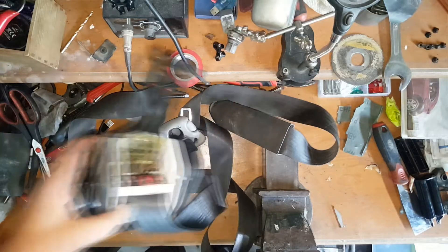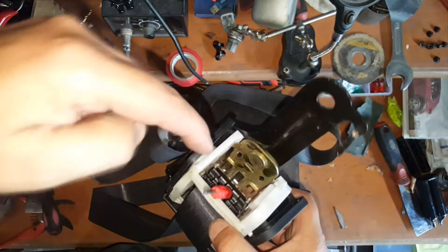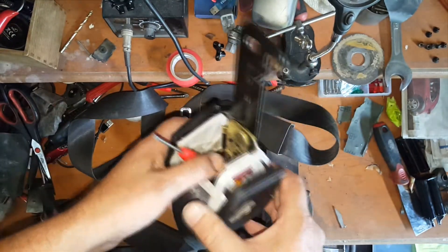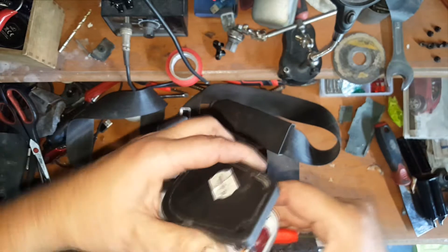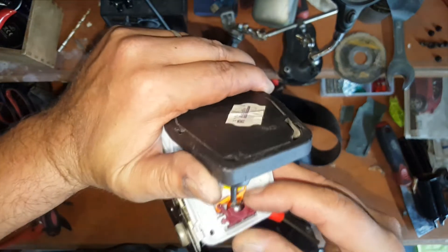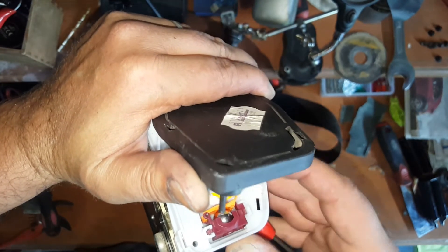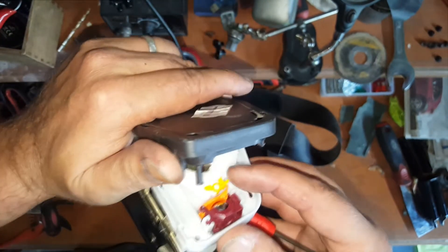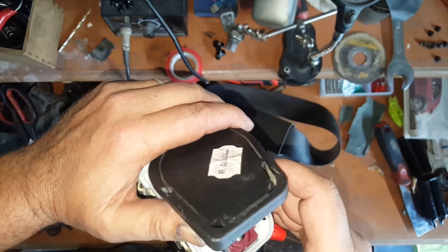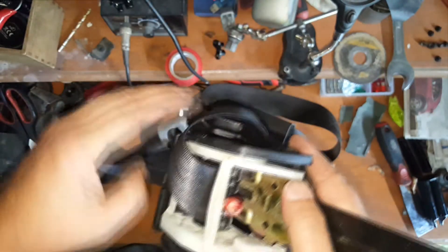I want to show you what it looks like once it's extracted. This belt had wound in so far I couldn't get it to self-extract. Just unclipping the sides here - you can see the mechanism inside. When this ball bearing sits at the right angle it allows slack, and that releases the gearing here. Just unclipping that, pulling that back by hand, then I took the belt out. Once I got to a certain point I let go, held the belt upright in its normal position as it would be in the car, and kept feeding it out.